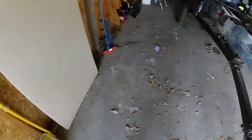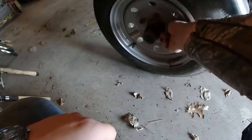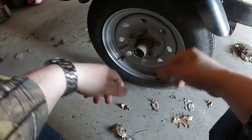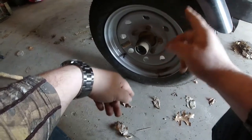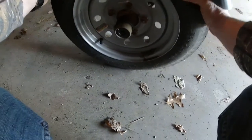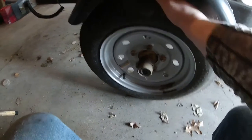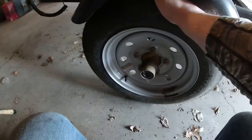So this is a trailer tire. Number one, you want to make sure your lug nuts are tight and your bearings have grease. Today we're going to be disassembling it and re-greasing it. One easy way to check if your bearings are properly greased throughout the year is to grab the tire and shake it. You can see this one has an incredible amount of play — this trailer should not be on the road.